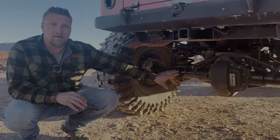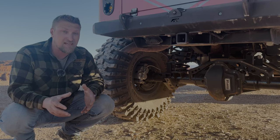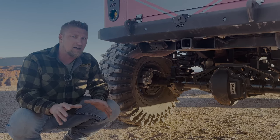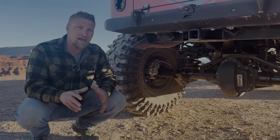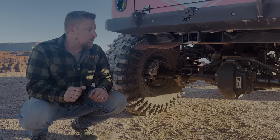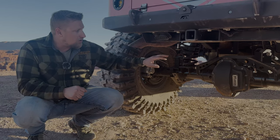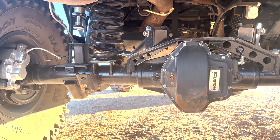Here's the Dana 80 rear end — very heavy duty, four-inch axle tube with half-inch wall and 1550 axle shafts. It has been an absolute beast. When we first bought this Jeep we tried UD60s and on the first trip I grenaded the rear end — the locker got destroyed and when I pulled the diff cover it all fell on the ground. So I went to extreme duty with this Dana 80 from Fusion 4x4. We'll put that link below.